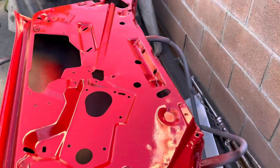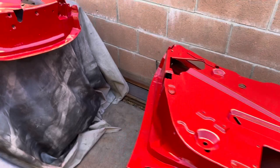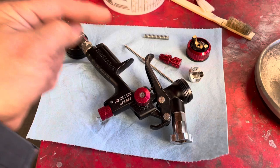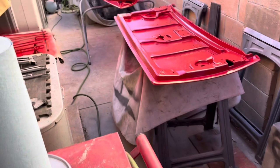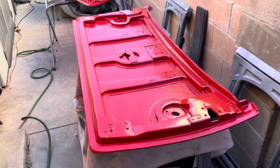I'm pretty happy with the paint - we'll see how it goes on the car. I kind of want a little more practice, so I'll start with the non-critical parts of the car, like the under valance and in the back where the exhaust is, and work my way up so that hopefully when I get to the fenders and the hood I've got some skills spraying this. I'm very happy with the way the little Harbor Freight gun performed. I pretty much set it wide open. I cleaned it a couple of times before starting. Take care of your gear. Sherwin-Williams Automotive single stage - so far, so good. Leave your comments below - I'll check in with you guys soon. Thanks for watching.